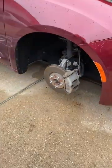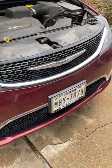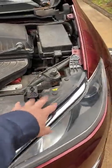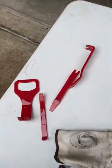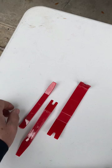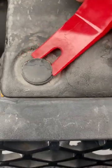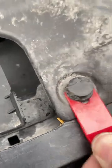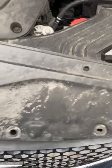With the wheels off, the fender well bolts are exposed. To take the front clip off, the first thing to do is pull out the 12 push pins on this plastic piece. I've got a push-pin removal tool from the auto parts store to make it easier. You want to get underneath the first part of the pin and lift up — once it raises, the whole pin comes up.